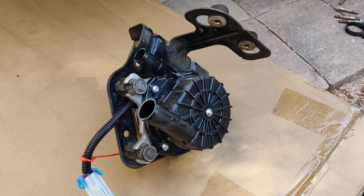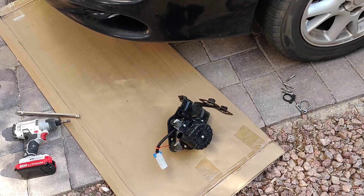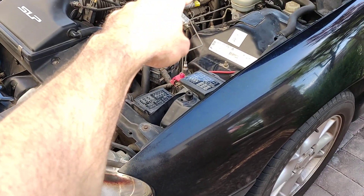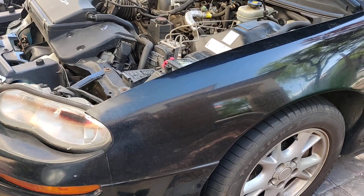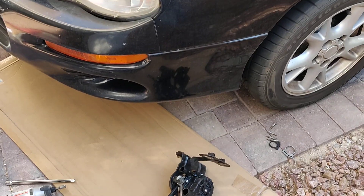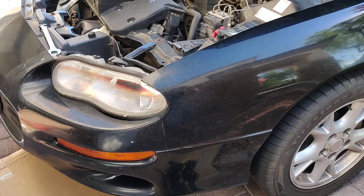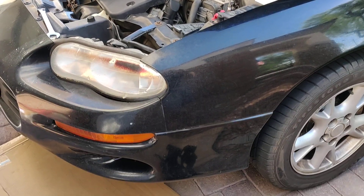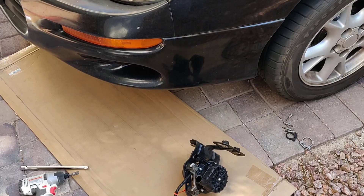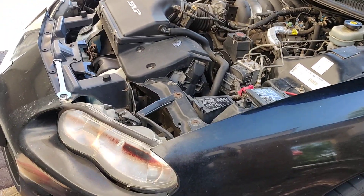Because I don't want to take this off after I pass smog — what a pain, right? And then you'd have the service engine soon light on all the time. So after I get this pump hooked up, I know the system is going to work right — it's just about all there is to it, except for a diverter valve and a solenoid up behind the cowling, which seem to be fine. After that, I'm going to reset the computer and do the GM drive cycle: a cold start, idle for five minutes, then drive at 55 on the highway for a few miles. You can Google it — GM drive cycles are all over. There are eight tests and you need seven completed to pass smog. Hopefully it works. If you have any questions or want that spare gasket, let me know. Thanks for watching.